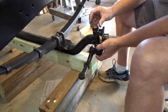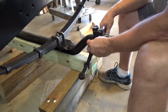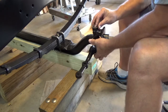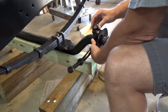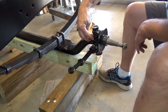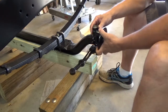Now what you want to do is take this tapered key — flat side towards you and the small end first — coming through the backside here. Slide it into there and then just kind of work your kingpin. There it goes — you can see it worked in right there. I'll take my ball-peen hammer and go ahead and knock that in further and get it flush. That will complete that process, and right now there's no play up and down.